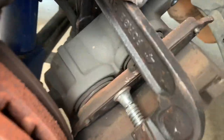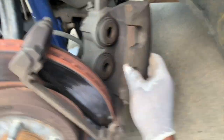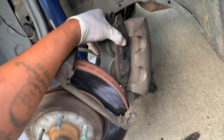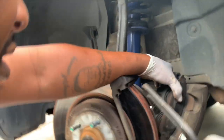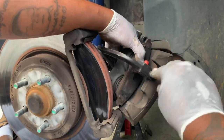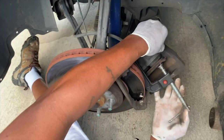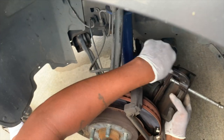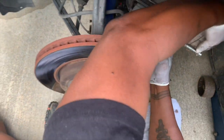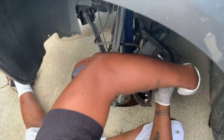See how they're going in — that's returning them back to their home place and it's going to allow me room to put the brakes in. I'm pushing them in a little bit more. I want to teach my son how to be self-sufficient and not need anything but God. Place the clamp on there and push those calipers all the way down — nice and good. They're all the way back to home, so I should have enough room.